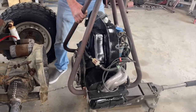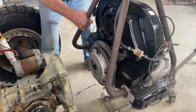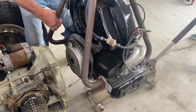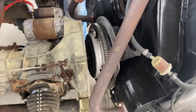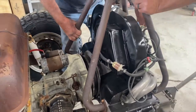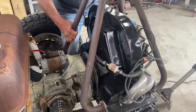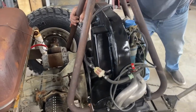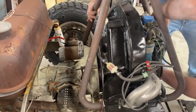With a VW engine you pretty much target the bottom two studs because they are the male part of the hardware — you can see them sticking out, you line them up and plug them in, and you're also looking at the center shaft that the alignment tool represents. This bell housing was for a smaller engine that's been clearanced, so one thing I noticed is it's a little sticky going in. I'll rotate the pulleys and see if we get a match.